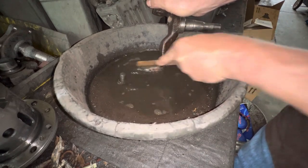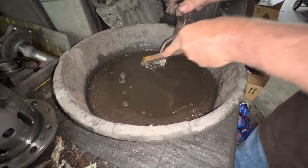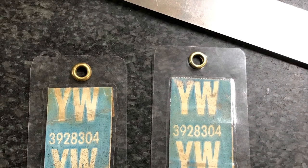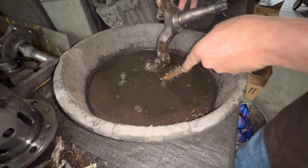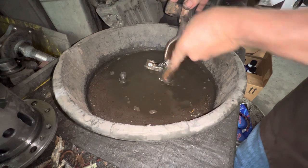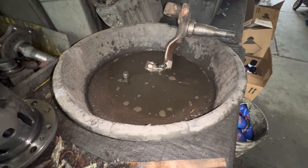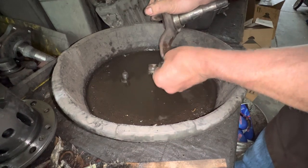Under the hood I didn't do all the stencils on the firewall or all the little stickers everywhere. I did some of it - a lot of it on the suspension. I retained the original spring tags for the front springs and I laminated them. I used stainless steel wire ties, basically like you do on an airplane, and wire tied the original spring tags to those front coil springs. I was actually able to save those original tags and thought it would be cool to keep them. They don't make a reproduction of that number that was on my springs.